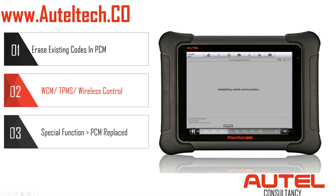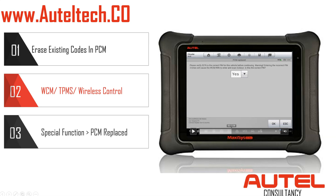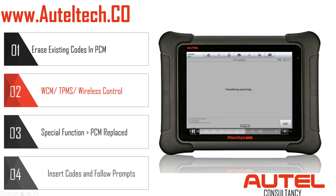From here, follow the prompts — checking ignition status, checking pin, establishing communication. Now we pop in the pin. One thing to note: if you're doing any immobilizer-related stuff and you try to access that system too quickly, it will set off the anti-theft system and it won't work. Pin code is correct — it takes the VIN number, updates it on the PCM, we press OK, and it transfers the secret key successfully. Cycle the ignition key before starting the vehicle.